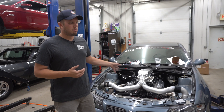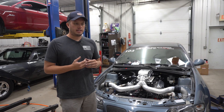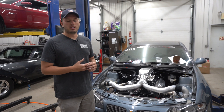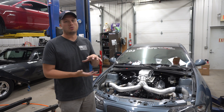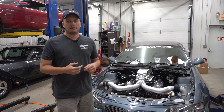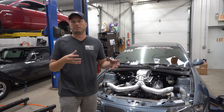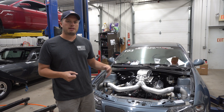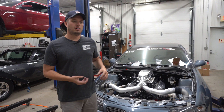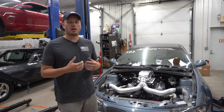On something like this — a gasoline engine, not ethanol or methanol — we've tested out these air-to-water intercoolers and they'll keep temps very low. On my Nova at 1500 to the tires, I think the intake air temps were like 101 degrees or something like that, which is extremely low for something making that much horsepower in such a small intercooler. They're really efficient. Because they're right here, we're not having to fish intercooler piping all over, which is big for horsepower. The nice thing about these all-in-one units is they're very low profile, so you can fit them under a lot of hoods.